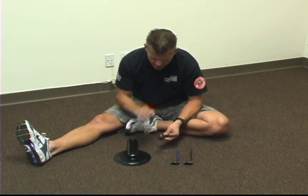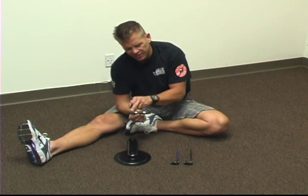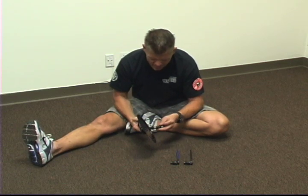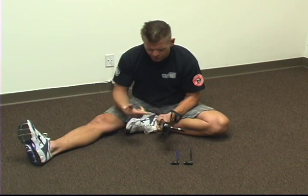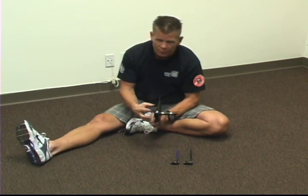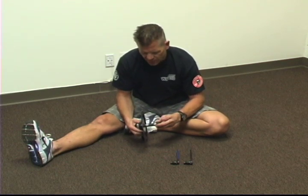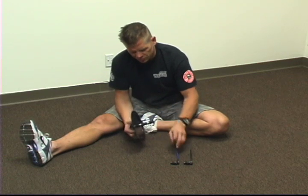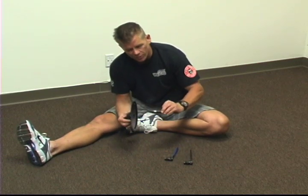Crank arms on a lot of bikes use old technology where the spindle is square and tapered, and the crank fits onto the end of the spindle, and then there's a bolt that comes through this side. You tighten the bolt and it presses the crank onto the spindle. So when it's time to do something inside the bike that requires removing the crank, you need to use a tool to press the crank off of the bottom bracket spindle.